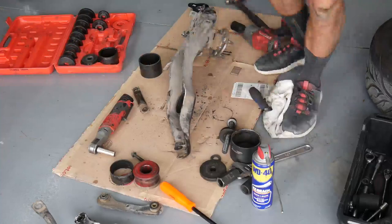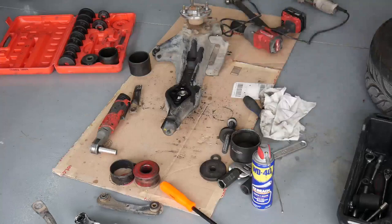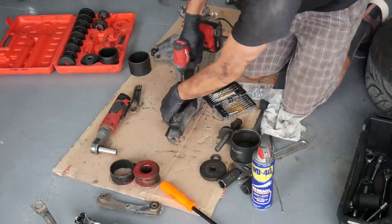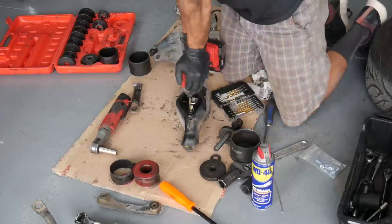PCI says that with the offset bushing the trailing arm might contact the body. So instead of hammering at the body, I ground down the little lip on the inside of the trailing arm - that way there's a little more clearance there. You'll see in a moment when it's installed there's probably about a half inch clearance, which I think is more than enough. With that bushing you also need to drill a couple holes to get the trailing arm bushing mounted.